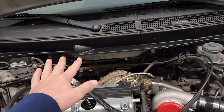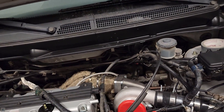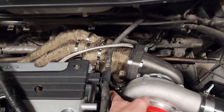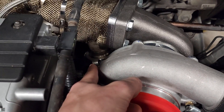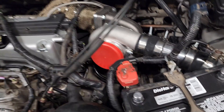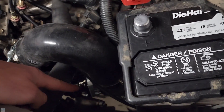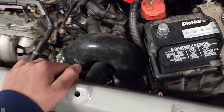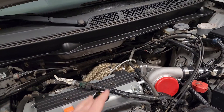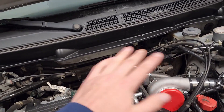The difference between a wastegate and a blow-off valve on a turbo setup is essentially that a wastegate is located on the exhaust or the hot side, and the blow-off valve is located on the cold side. They both serve their purposes of relieving pressure, but they go about it in different ways.